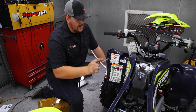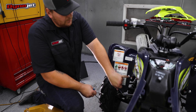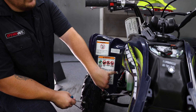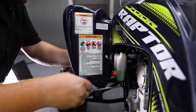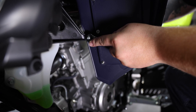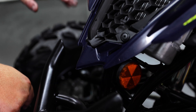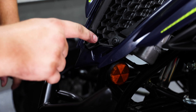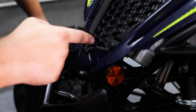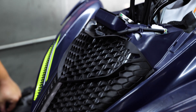While removing the shroud, after you get the other 10mm bolt out, you're going to come down to the Allen head bolts — there's going to be a 10mm nut on both sides on the back of them. After the removal of the top shrouds, when you come down to the front of the fairings to get the side fairings off, you're going to remove the two push pins and the 10mm bolt right behind it, come up and disconnect your gauge cluster, and the whole front plastic should come off.